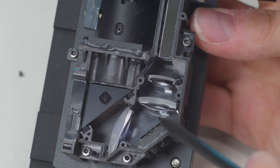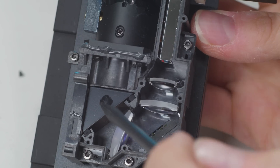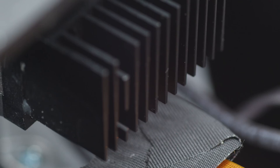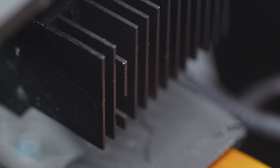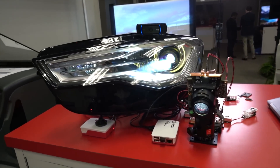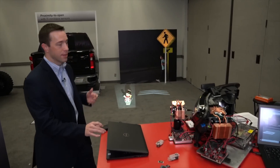One position sends the light down into lenses and out into the world, and the other direction sends it straight into a heatsink painted black, where it's converted to heat and blown away by a fan. The black coating on the heatsink absorbs it, because light not bouncing off a surface is what makes something black. With the right light source and optics, you can project a crisp image with blacks that are absolutely pitch black because the light never leaves the projector.